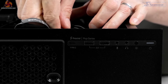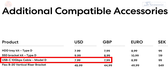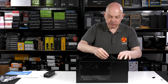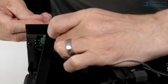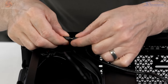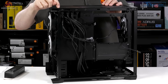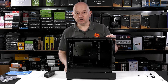Let's remove this blank because I do want to put USB Type-C in this build. We take the accessory, which costs less than a tenner, and now we have USB Type-C as well as Type-A. Let's just demonstrate the daisy chaining of the fans — we plug it into the header in the roof of the case. Now the three fans are controlled by the RGB button on the front IO. I'll leave it like that to see how well that hardware control works in practice.